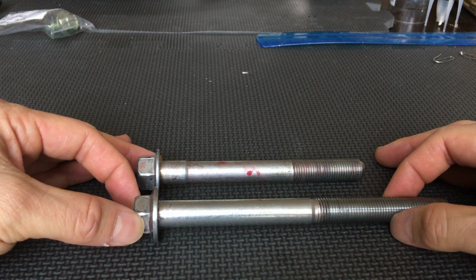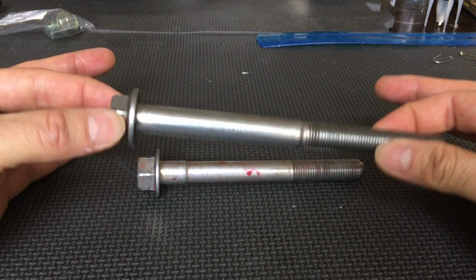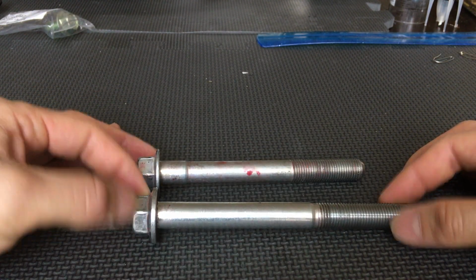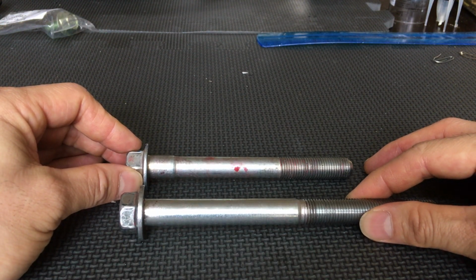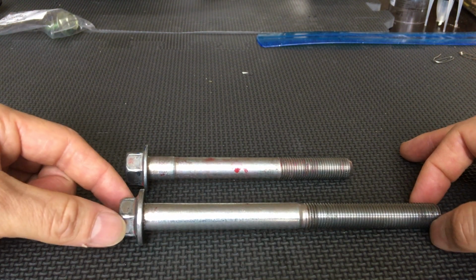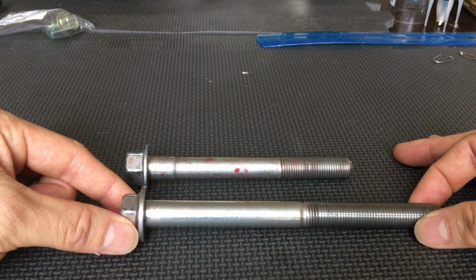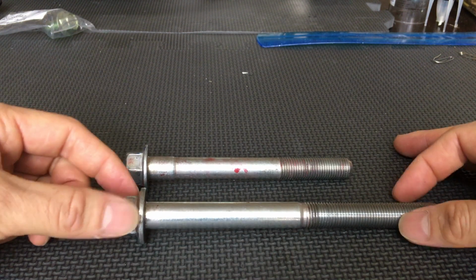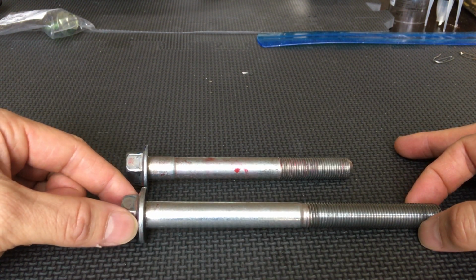I did talk to a member of NASIOC. He owns a Type RA. He has a pretty big journal of all the stuff that he did. He actually replaced all 4 subframe bolts with the STI extended subframe bolts. I went in and talked to him about it, and he confirmed, I suppose with the vendor, that the S207 used 4 subframe bolts that were elongated. I just took his word, and I went ahead and also replaced the back 2 subframe bolts.